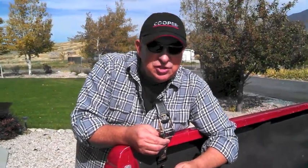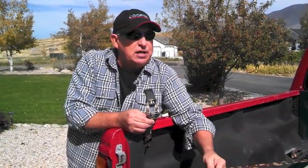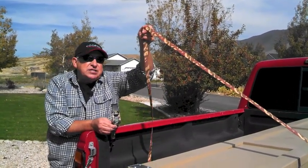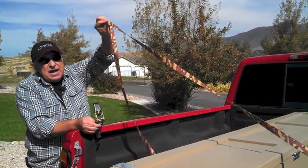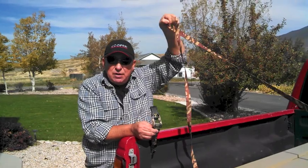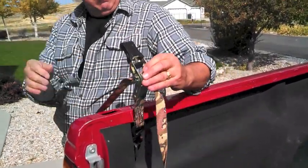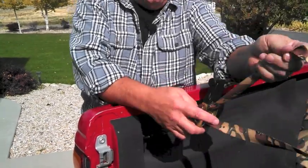Here's a quick bonus tip: if you're putting straps over a tall cargo container and they run at a high angle, they'll tend to buzz and vibrate in the wind badly. That's why you'll see professional loads on the highway with their straps twisted — that's intentional, to reduce vibration and quiet the load. Now, find the end of the passive strap, pass it through the slot, pull it through like threading a needle, and feed it back.